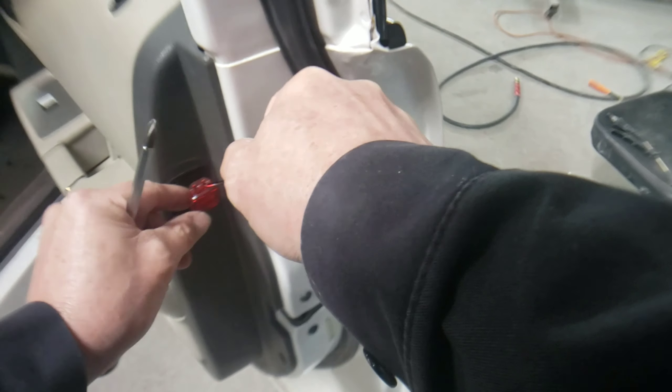Here's a good look at the new mirror. You can see the four openings where the cover slides in. There's a tab in there — you pry that little chrome trim up so you can pull it out. On this one, you pry down on the top ones and up on the bottom ones to release the chrome cover. So that's how you remove a mirror and a door panel on a 2011 Ford Flex. It is a little struggle getting that chrome cover off, so just be patient.